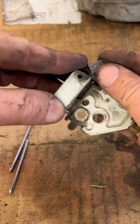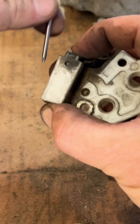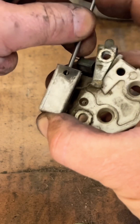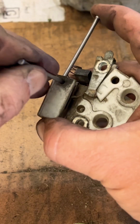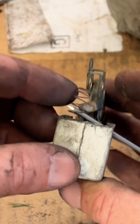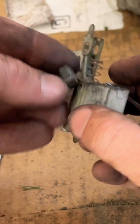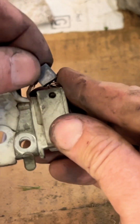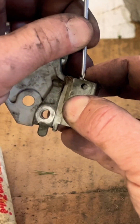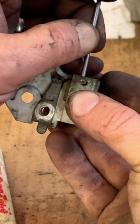Put your brush in and you're gonna take two nails. Use your first nail to push this brush down far enough that you can get the second nail through the hole inside of that brush holder, just like that. You may notice it's pointing up through the spring of this other one — just pull it back a little bit. We're gonna repeat this process on this side: use our nail to push that down until we can get the other nail through the hole on this side.